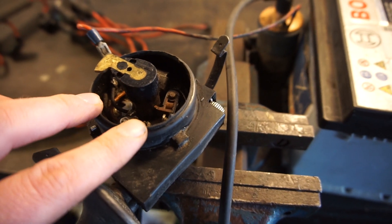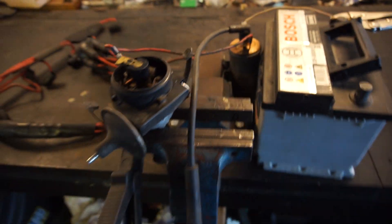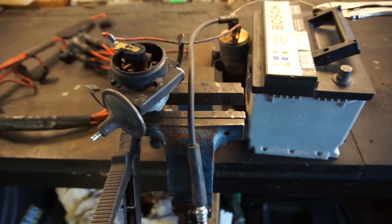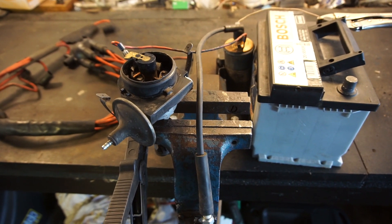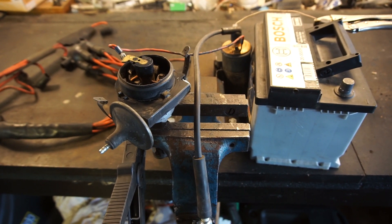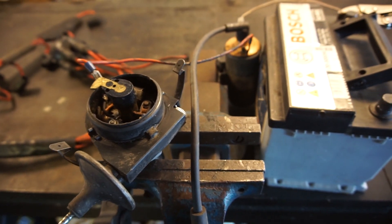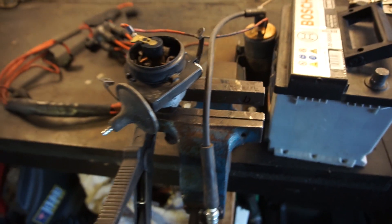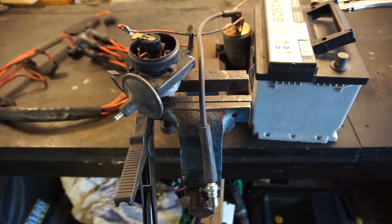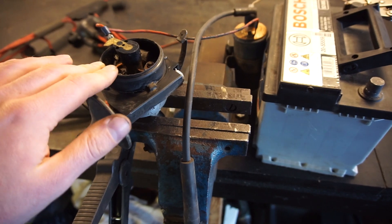It definitely hasn't been looked at for a while. But the funny thing is, I set all this up, grabbed the coil from that car as well, just a spare HT lead, spare spark plug here, and everything works. So that is a true testament that a points-based ignition system is really, really reliable. Of course everything can go wrong, and we'll go into that a little bit later. But if it's set up properly, it is actually more reliable than people think. Everyone wants electronic ignition, but good old points will usually always get you home.